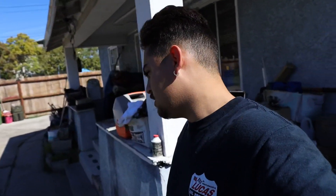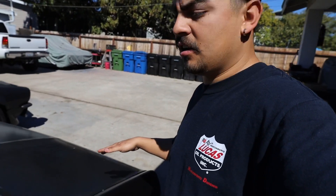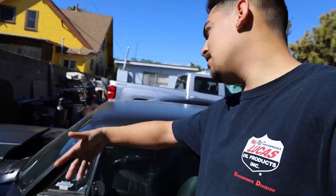I'm gonna be doing most of the sanding and not really the body work, but I'm gonna just get this paint all the way down to bare metal, working one panel at a time at my own pace. My brother is busy anyway so who knows how long it's gonna be primered. I'm gonna start with the deck lid today — the trunk — and sand it down to bare metal using a DA, then probably move to the doors or the fenders.